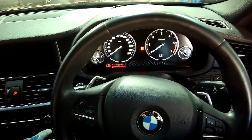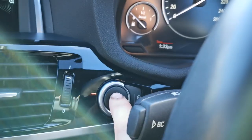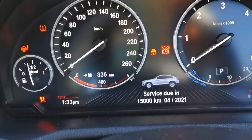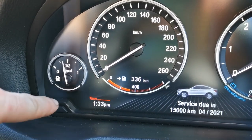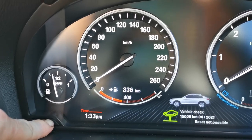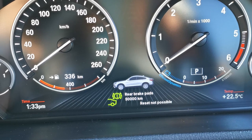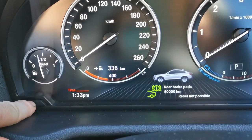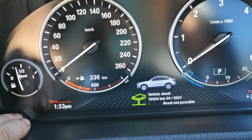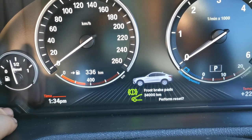There's only one more thing to do: reset the warning on the dash. The brakes are all good with new pads and a new wear indicator, but the warning will still be on the dash and needs to be reset. Push the start button once so the ignition comes on, then go to the odometer button and press and hold it. The different options come up — scroll through to the one in red, which in this case was the rear brake pads, then push and hold the button again. A reset bar will appear — I'll demonstrate on the front brakes: press and hold, perform reset, then press and hold again.